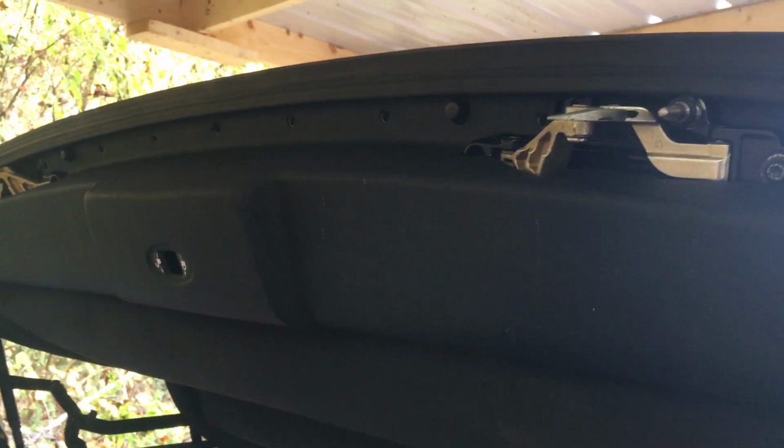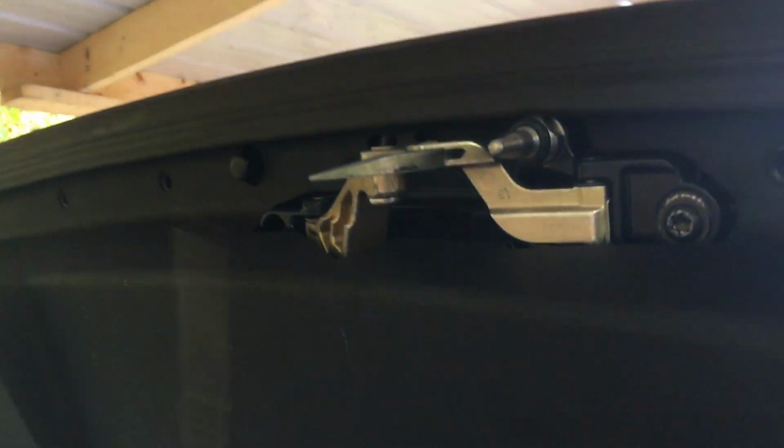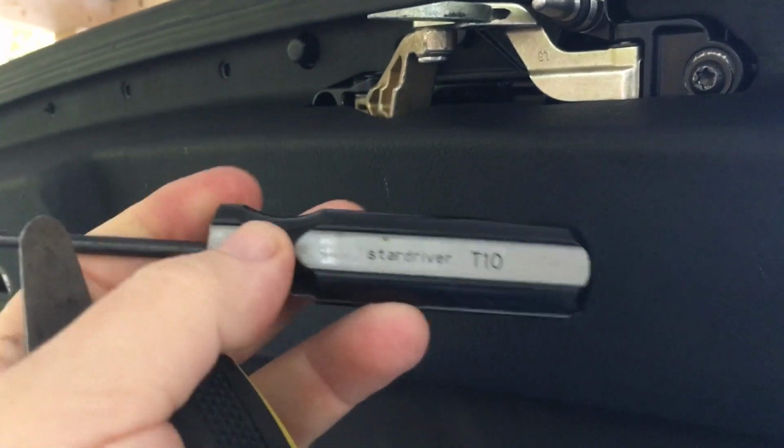This metal cover, it's got screws across the leading edge of it. They're number 10 Torx. They've already been taken out. Those other black things you see in there are just like a stud, a locator, or whatever you want to call it. There's a stud on each corner with a nut on it covered up by a rubber cap. Just peel that rubber cap off with your fingernails or stick a knife blade under it and just pop it off.